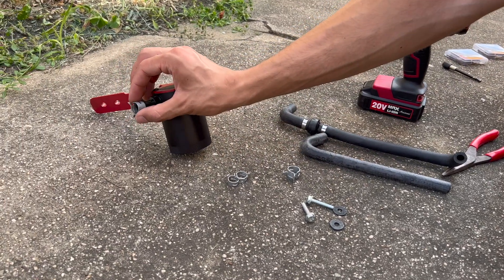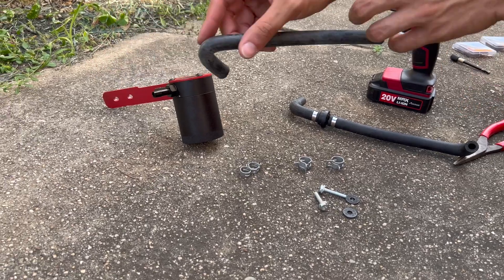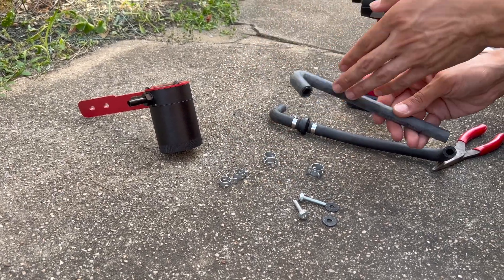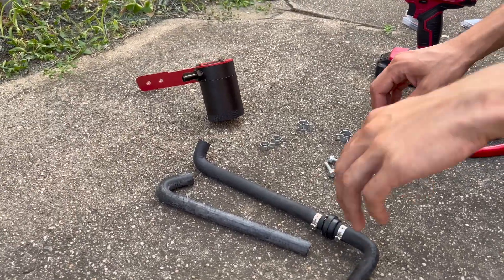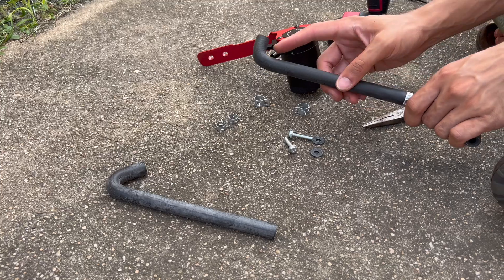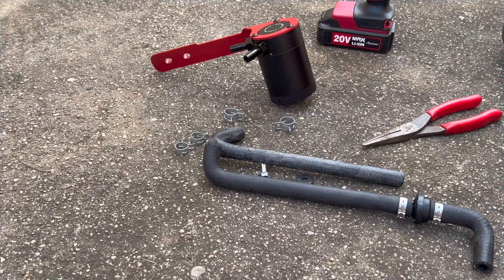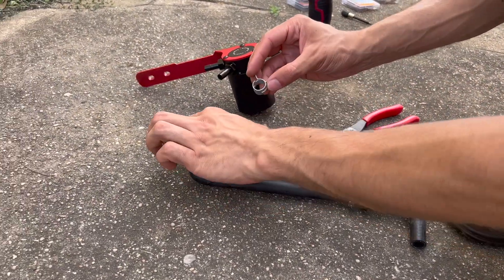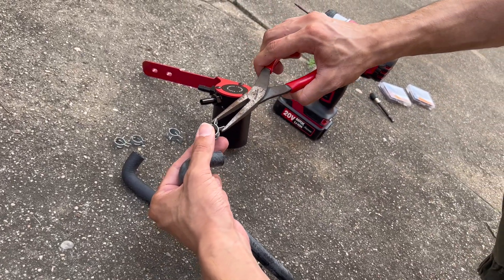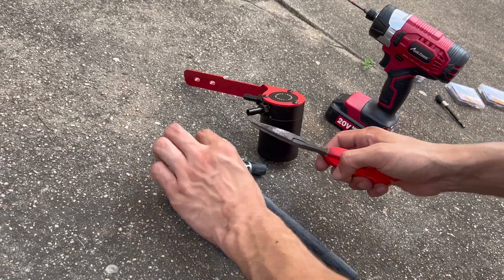These are going to have bigger clamps right here going towards this side, so when you put it on the hose the bigger clamps go on this side and the small ones go on the OEM tube that you're going to take out. Going to the can — you see the angle on these valves? That angle is the one going in. The larger clamps need to go in there, so I'm using needle nose pliers — it works really great for this. Just put it right here for now, then put the other one in.